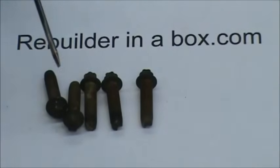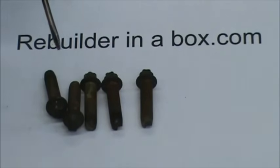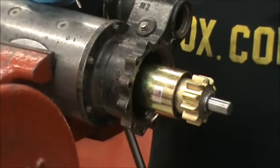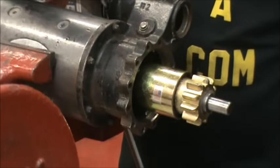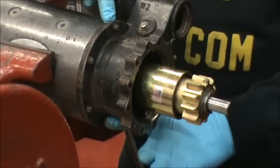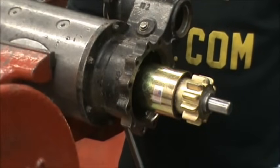Prepare the five bolts for installing on the lever arm housing: wash them in solvent, spray them with WD-40, or clean them with a wire brush if they're rusty. The main thing is to put at least a couple drops of oil or some white lithium grease on them so they don't become galled or rusted in the housing. When tightening these up, remember that the rubber seal fits pretty tightly — you can put a little dielectric grease or RTV around that. When tightening the E8s, use a diagonal pattern so it doesn't bind. Tighten one up about halfway, then go 180 degrees and tighten that halfway, and work your way around to get everything in squarely so you don't break a bolt or bind it up.